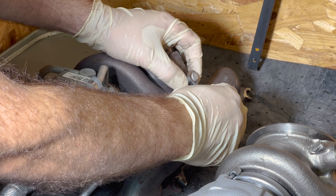Putting in the new downpipe gasket — slide that in from below. Reached up in there and tightened up the line for the coolant. Bringing over the downpipe. Now I'm going to start putting on the sound deadening. That's the inlet that comes with the turbo; I'm going to be installing that now. I already got the inlet installed and snapped this line on here. Wastegate line on — bring it over the air box.